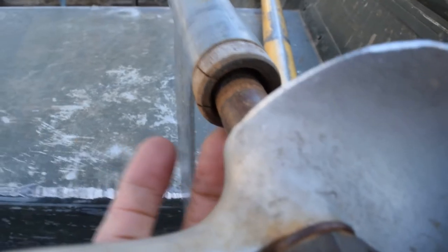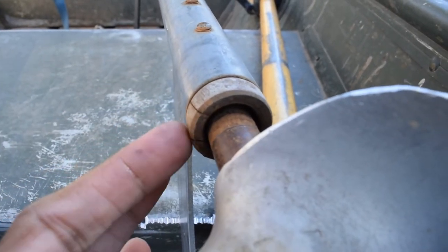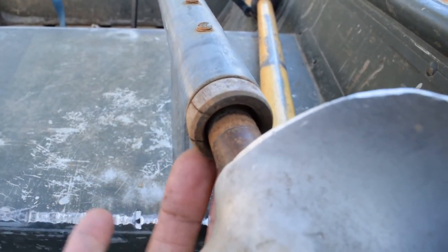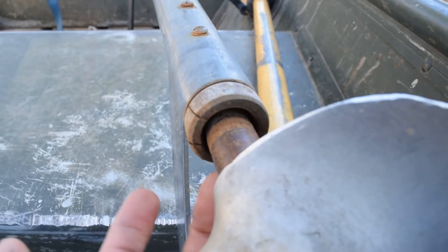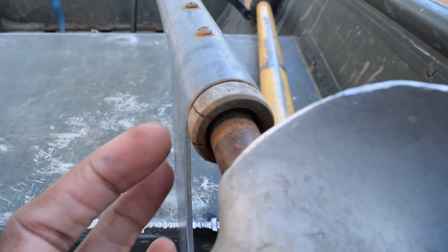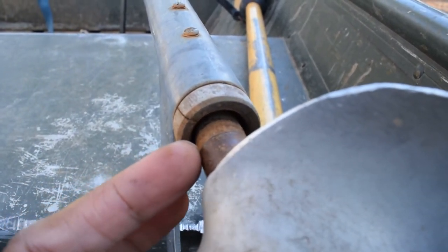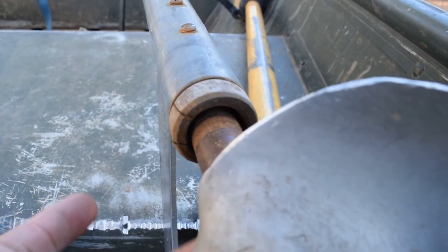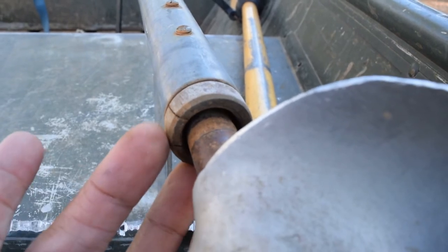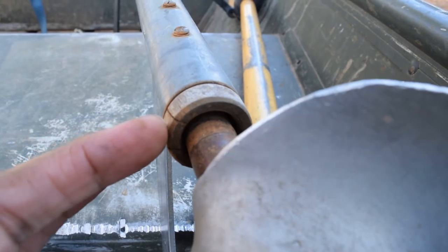So I called the guys. I probably talked to Junior at the shop at SPS, and we talked about the brass bushing and the wood bushing. At that time, I chose a wooden bushing because the brass bushing is a lot more expensive. And two, if you had a brass bushing here and a steel element here, you're talking about electrolysis in the water, with this thing spinning at 3600 RPM. You made a battery there, and you've got to worry about extra corrosion. I decided to get the wooden bushing.